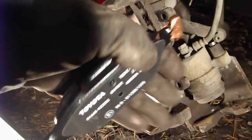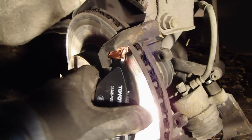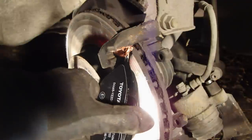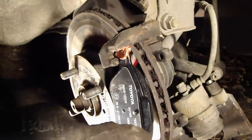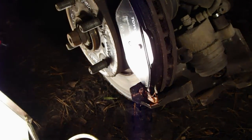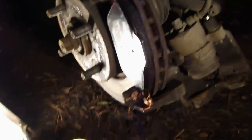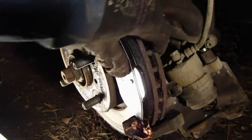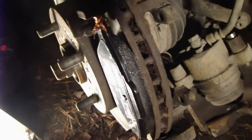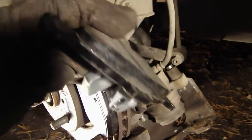And then I insert that brake pad in there, in that way. It goes first in the up area and then the down area. That's the idea, it is easier to install in that way. And then I press this brake pad in there. And then I use a hammer, my tool, with a little bit of knocks and hits. It looks good. Okay, and then the other brake pad, also copper paste in there.